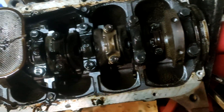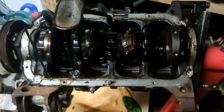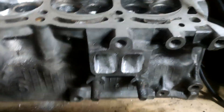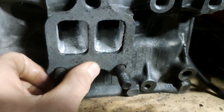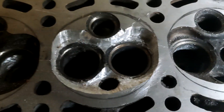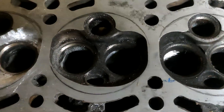The whole engine is going to need a complete rebuild. My overall purpose for doing this engine rebuild is to get it ready for my car — my green one — which is a turbo blow-through carbureted setup. I've got this head here that I've port and polished, and as you can see I've port-matched it to the head gasket, then went all the way into the cylinders and ground them out. I'm grinding the head cylinders out for lower compression, which will be good for doing turbo motors. That's the stock compared to the modified version.